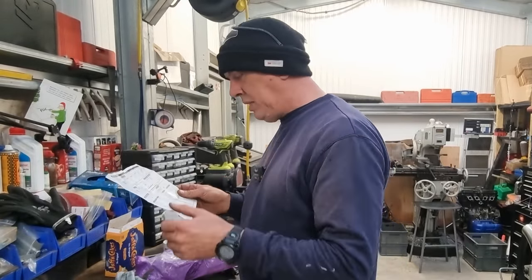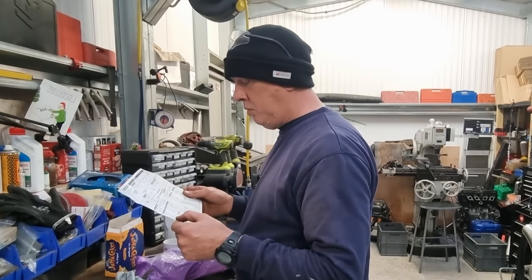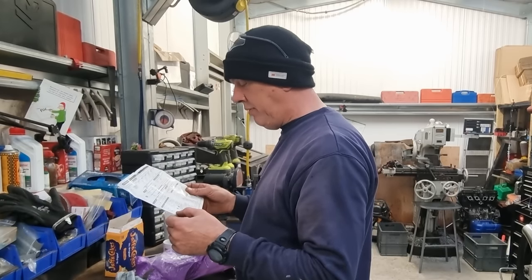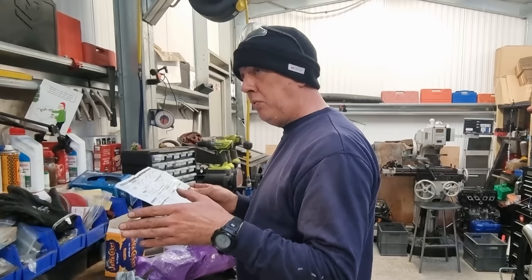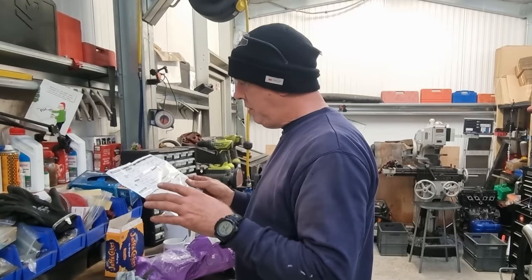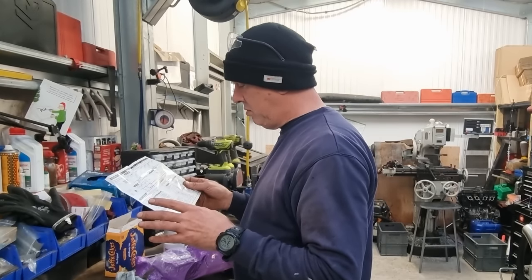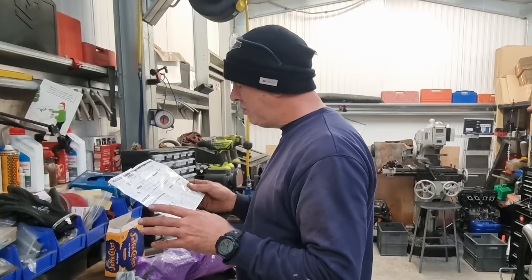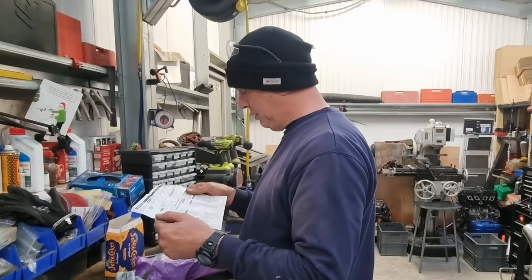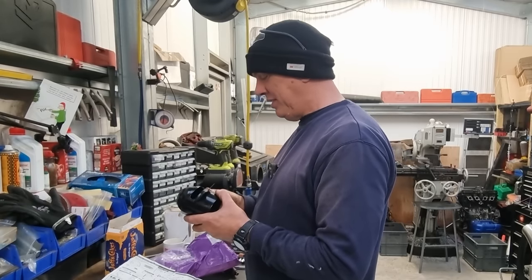So when you come to calibrating it, there's three different options on how you calibrate it. So you can do an auto calibration mode where you essentially drive exactly 1 kilometer, which I suppose you could track on your phone. You do a speed adjust where you go along with what you think it is, like 30 or 50 or whatever, and you see what it says, and then you can adjust it that way. Or there's a manual mode, which sounds a lot more like going into tire circumferences and all that sort of stuff, which is a bit of a pain. But you need to be able to get to those two buttons on the back to set the bugger up. Only trouble is, you can't. So I need to change this.